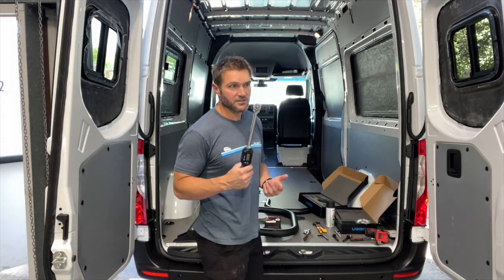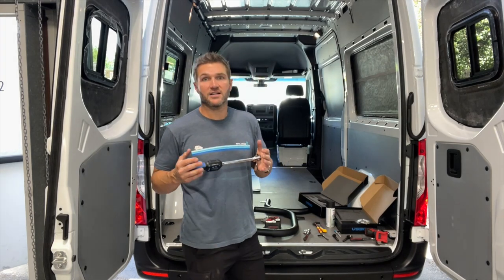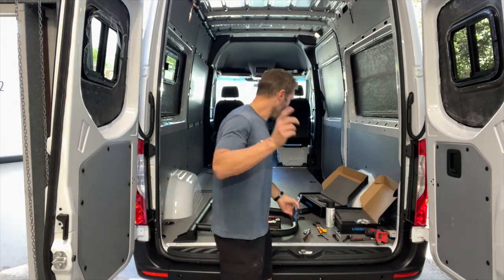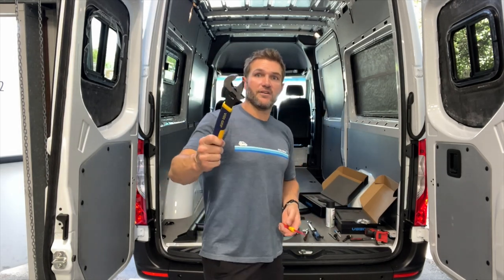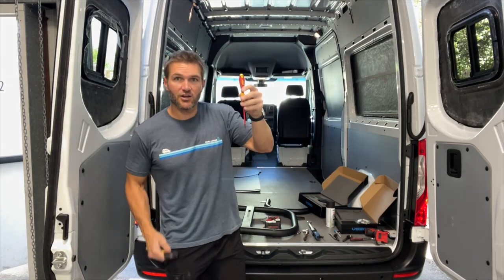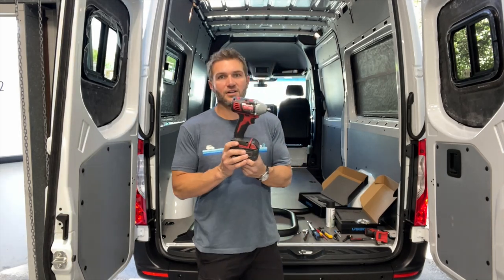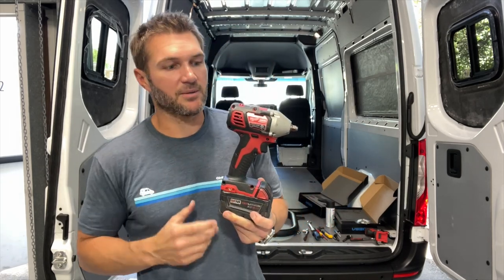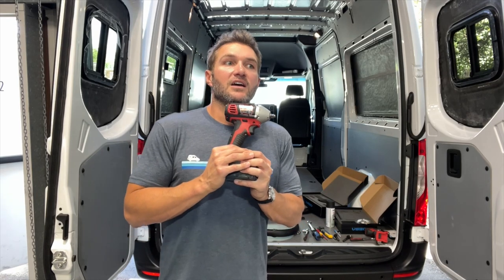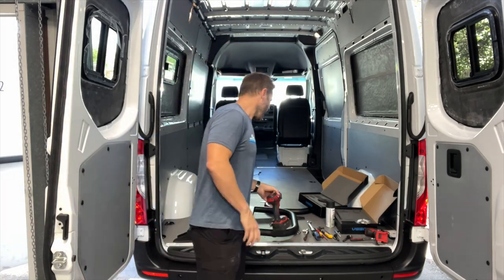Nice to have is a torque wrench — we'll talk about some torque specs, but with stainless steel hardware, which is fairly soft, the torque ratings aren't that high: about 25 to 30 foot-pounds on the hinge mounts. For putting on the all-thread at the very end, you'll want an open-ended adjustable wrench and something long and thin like a screwdriver to go down into the all-thread while you tighten it. I don't love impact guns for this work — a lot of our hardware has nylocks, you don't really want impacts with nylocks, and impact guns make you go fast, which leads to cross-threading. Go slow and do stuff by hand.